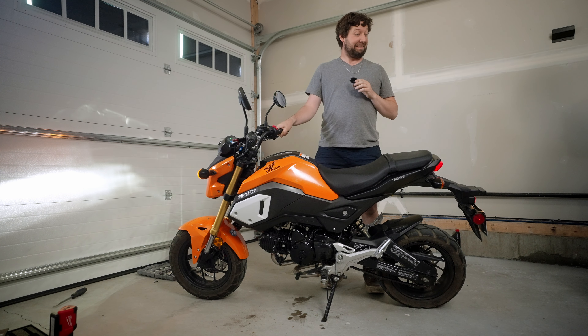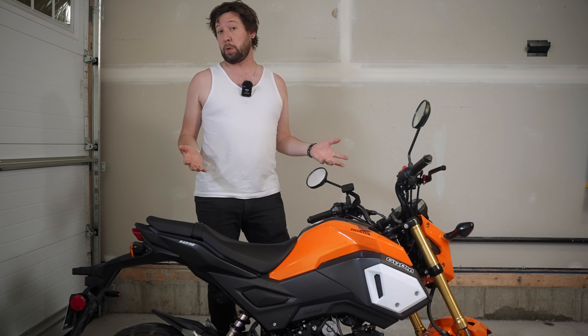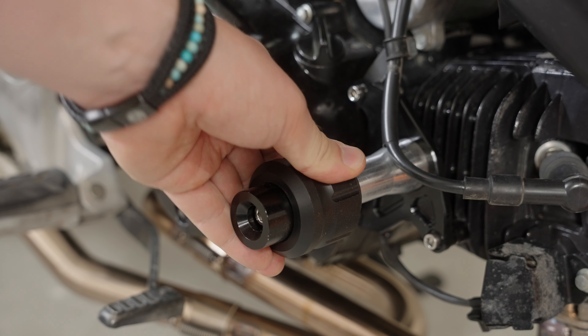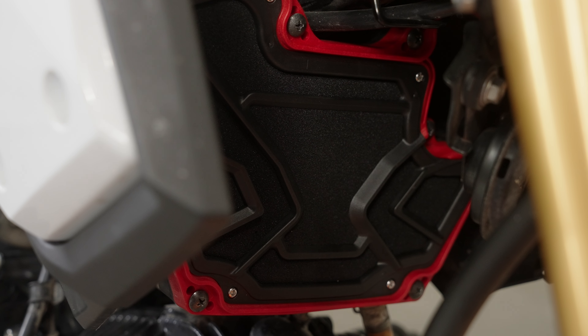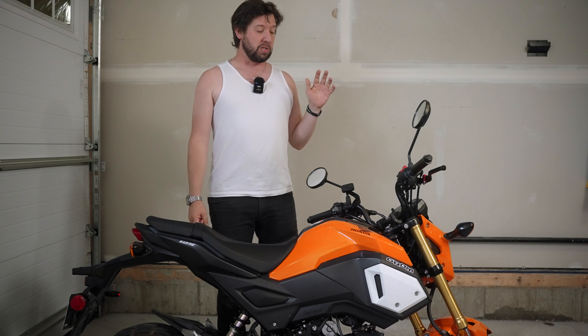Two weeks later. I have no beer, I have no Dentin, but I was still able to put on the rest of the parts without too much trouble. We have the fancy frame sliders on now. I wasn't able to buy another Chimera intake, so I opted for the next best thing, which was a COSO tube airbox mod, which will give us similar performance. I'm going to show you the control tests, but keep in mind the numbers I'm shouting out are the indicated speedometer, which is notoriously bad on a stock Grom, so I'm going to flash on the GPS kilometers as well, because that's what we're going to use to compare the speeds.